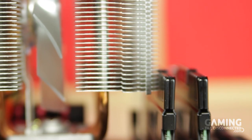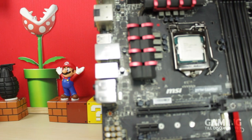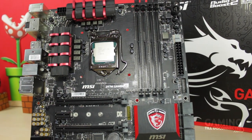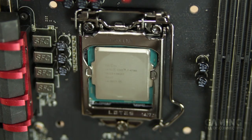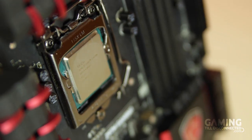I would be sure to confirm that there will be enough room between RAM sticks that have tall heatsinks and any aftermarket air-cooled CPU heatsink you may have attached. Between the VRM coolers and DIMM slots is the CPU socket. Being a Z97 motherboard, the Z97M supports LGA1150 Haswell or Haswell Refresh processors. It should also be able to support 5th generation Intel processors, slated for release in 2015.